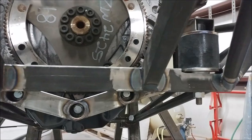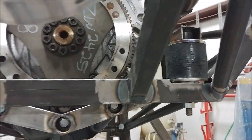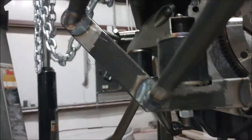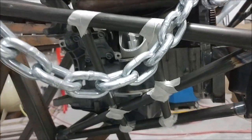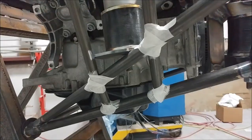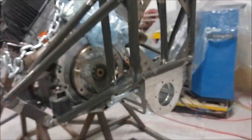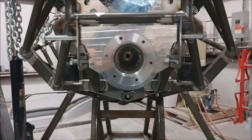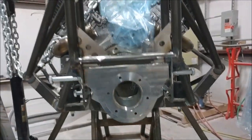Back on the engine — I was having a little trouble aligning the engine to where the belt drive needed to be. I figured out the reason: these Corvette engine mounts are supposed to be 2 and 3/4 inches high, but it turns out they're 2.95 inches high — 0.2 inches too tall — which was driving the engine up too high. I had to slot the frame about 0.2 of an inch, and we're going to weld a plate in there. As you can see, it lines up nicely now.